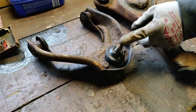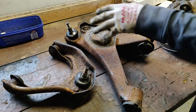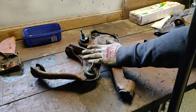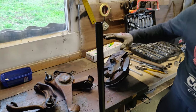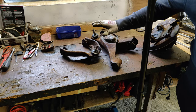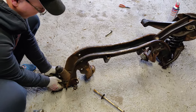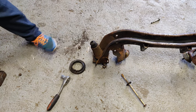This one gets out of the car, out of the wheel arch, and then both of these will be primered and painted with two component paint. Not powder coated, because powder coating would involve getting them in the oven, which would basically destroy the bushings. Gotcha. But the suspension bridge, however, is going to be powder coated. And that rubber piece you can remove, right? The stopper? Yes. Okay.